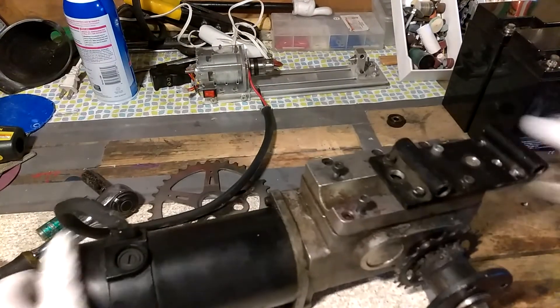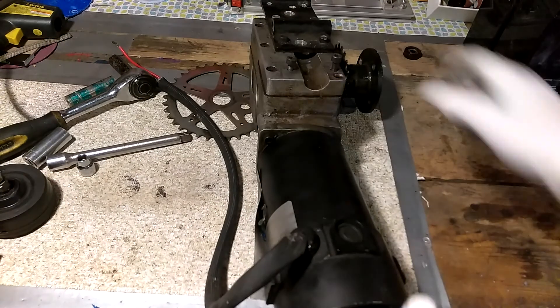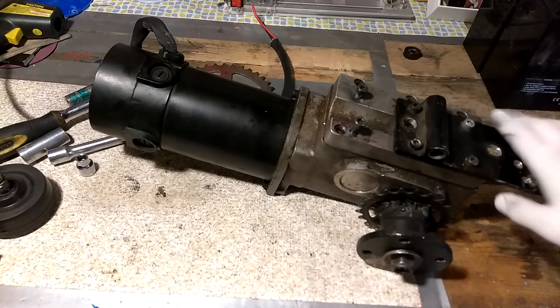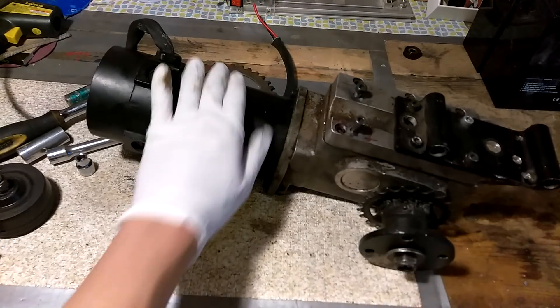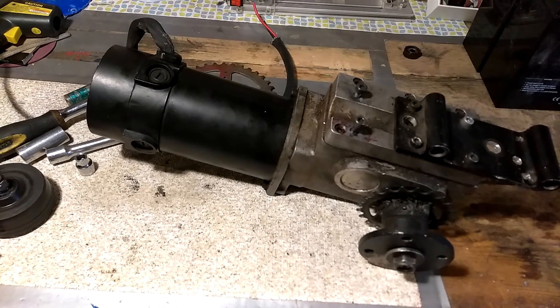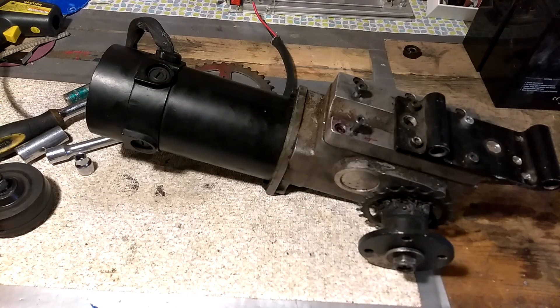Going back to the 500-watt motor — since I have two of these salvaged off an electric wheelchair, one hub goes this way and one goes the other, giving you a left and right motor. Since they're brushed motors, we can run them either direction. And since I have extra parts, I can just swap the motor if this one fries too. I think this project was probably much needed because the bike was underpowered. Hopefully I can figure out how to set up the rear rim to accept two sprockets and we'll hack this together over a couple more videos and take it out for a test drive. If you like my channel, please subscribe, give me a thumbs up or down, and until next time — build stuff and have fun!